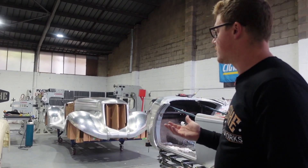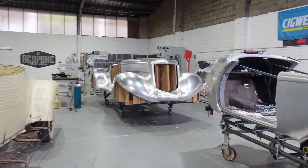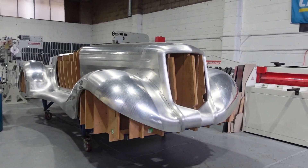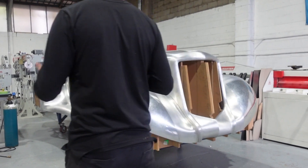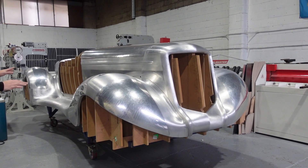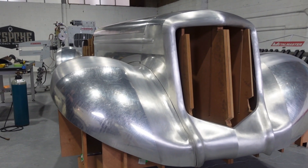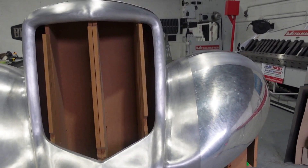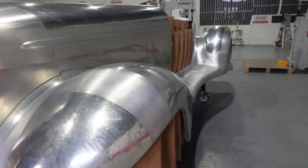Just to finish off the video, I wanted to give you guys a little bit of a shop tour. The Auburn in particular is a car that you guys have probably seen a lot on social media. I just wanted to talk through what I'd done — when I was filming this car I had a client's car in the shop that wasn't able to be seen, so unfortunately we weren't able to show as much of this car as we wanted to. The filming logistics just didn't work out, but we can go over it now. Everything on this car is basically completely scratch built from a standard 1935 Auburn Speedster. The only thing that can cross over is the center of the door skin. Everything else I've changed — made the grille a little bit wider, added sweeps, put more volume in the guards, widened it, put the running board. I created that running board design — they never had them originally on the Auburns.